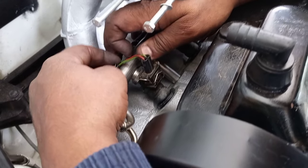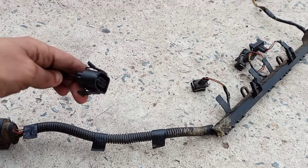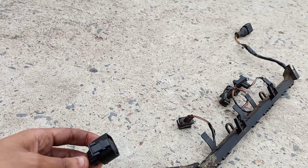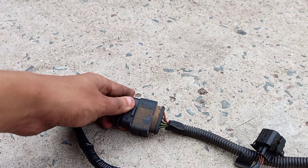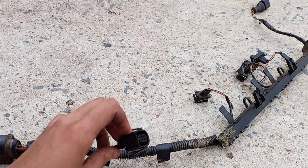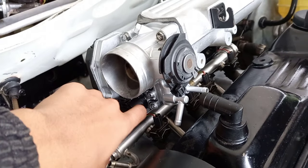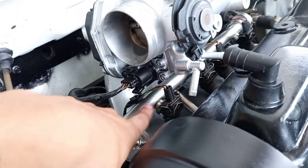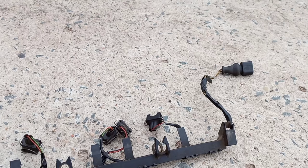As you can see, to connect the plug onto the injector you simply push it on and you're connected. If we follow the loom down, the next plug that needs to be connected is the one for your throttle body. You run through a connector, and once you pass the connector you'll find the plug that goes onto the throttle body. There's no need to modify or cut any wires — it just plugs straight on.